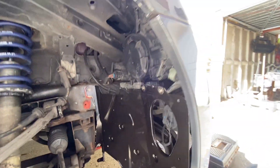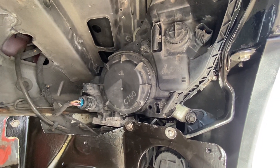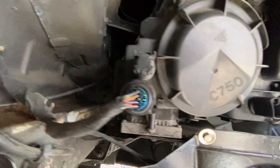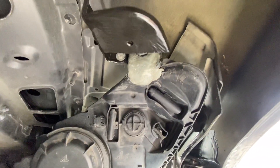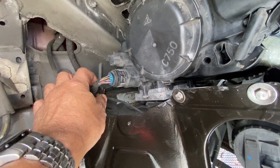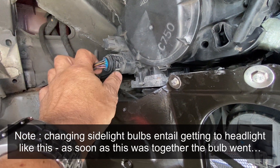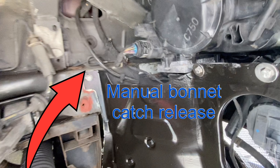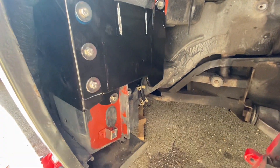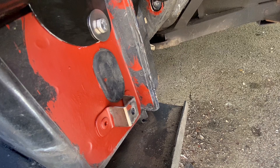So there's the front panel all in. I've got this gap night-on perfect now. It took ages to set up the headlamp — I had to use washers on the bracket I made up because I couldn't use the adjusters; the adjusters everywhere else work fine. So there's the bracket up there, a bolt there, bolt down in that corner, and a bolt up there — two bolts in that little bracket. That's the headlamp. This connector is one of those ones where you have to slide the grey clip out to the side and then you can pull it off. Quick note: while I had all this apart, there's that little round hook — it's a manual bonnet catch release should you require it. I've bonded everything, welded up that panel, put all the boxes back in, using stainless steel bolts and washers, and there's the little bracket I made up, new and pop riveted back on. So I'm ready for the wheel arch, and then she'll be back on the ground.